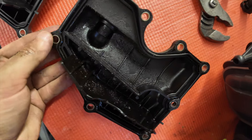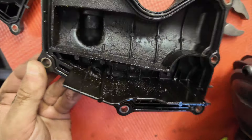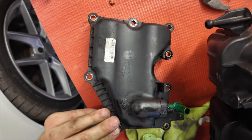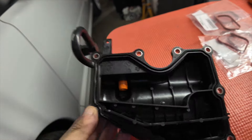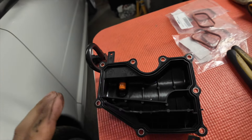So this is the old PCV valve. As you can see it's pretty oily — caked in grime. I don't think this was replaced when the new block went on; it just looks really old and dated. Here is my replacement — a nice new unit, exactly the same, with a new gasket. Hopefully this will fix that slight burning of oil. This sounds like the first logical step as it has the characteristics of a failing PCV — firing oil back into the inlet manifold and causing blue smoke out the back rather than dumping it back into the crankcase.